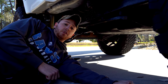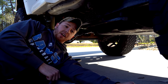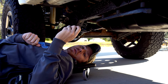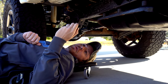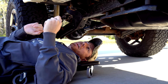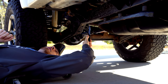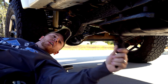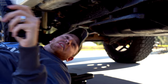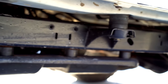There'll be chunks of rust like bark of a tree. And if there's no rust there, chances are the rest of your frame is pristine. So you're going to want to bring a knife - or a screwdriver, just something to poke with - when checking the frame. Open up your knife and check around here, and hopefully your knife doesn't go through any of it. If you don't have rust there, the frame of your Jeep should be fine.